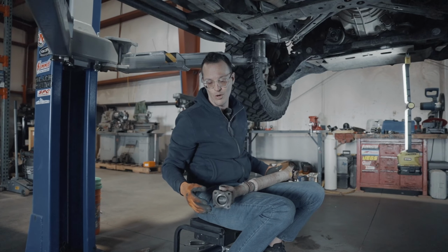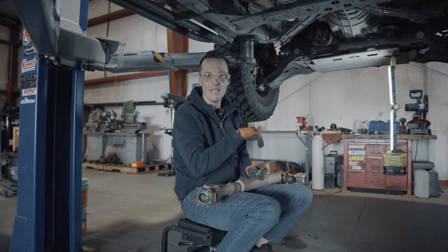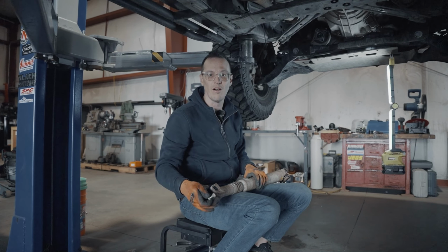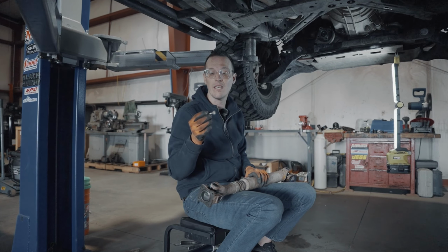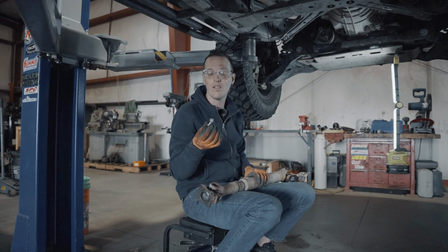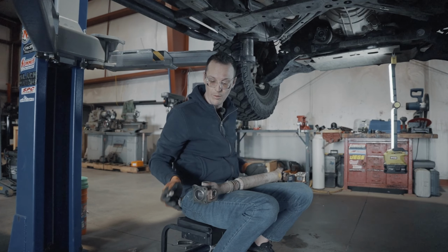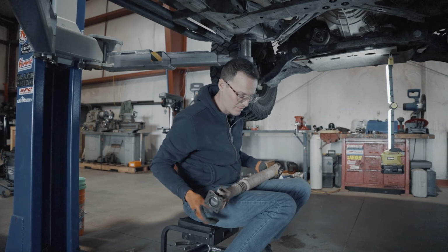It's going to be reverse order in the way that you took it out, so it should be nice and easy. There's going to be 4 bolts on each side. You reuse the ones that you took out, and you torque them down to roughly about 44 foot-pounds. To do so, it's going to be a little bit hard because it's going to be hard to get a torque wrench on this, so your best bet is to just give it the good old heave-ho and make it as tight as you can with your hands. Typically, that's around 50 foot-pounds roughly for the average person. We will slide this bad boy in and install some bolts.